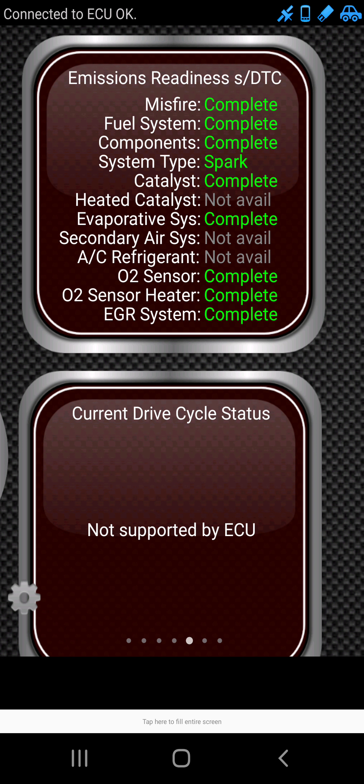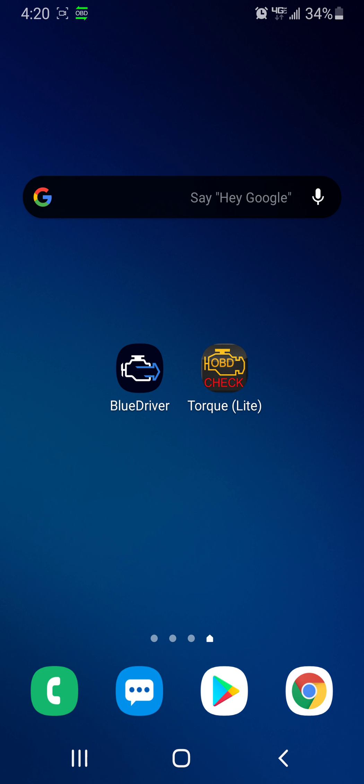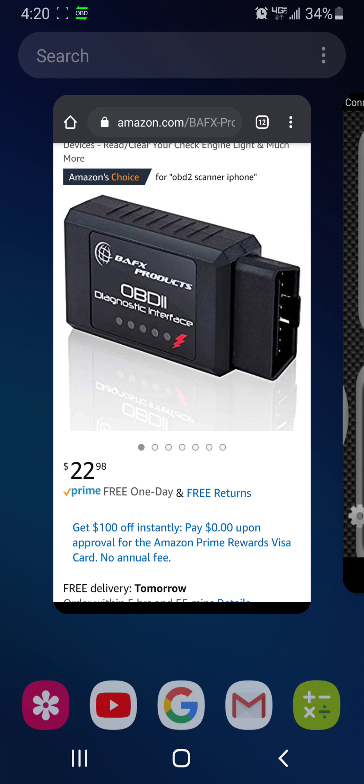Other than that, it's my O2 sensors. If the needle is solid and not fluctuating like this one, it's probably the O2 sensor that's causing the issue and it needs to be replaced. This one only has two — pre-cat and post-cat — only has one cat. There are cars that have multiples, up to three or four apparently. I wouldn't want to mess with that kind of car.